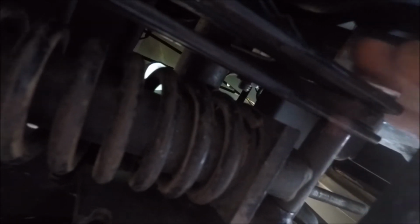Moving up to the front, this is where it gets a little bit more interesting. As you can see here, I have the rear lift arm, and it was pointed out to me that by installing that ahead of time I would have to repeat that when I did the spring assist, and those who pointed that out were right. It's not that big of a deal. It just ends up being in the way a little bit while you're doing the installation. You don't have to completely remove it back out of the tractor, but you do have to disconnect it from the rock shaft right here. You also need to remove the secondary lift arm right here.